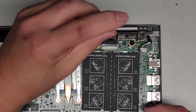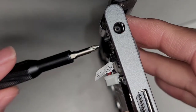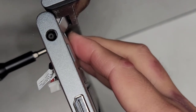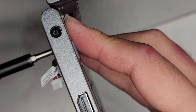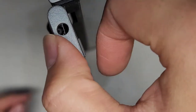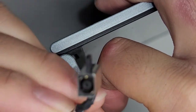Next we're going to open up the laptop to about 90 degrees, and then while it's open, we're going to undo the screws holding the hinge in place — there are two. You've got this screw here and this screw here, so we're going to remove those two. Keep track of those screws; you don't want to get them mixed up. I'm going to add some thread locker after doing this, just so those screws don't come loose later. Once you've done that, you can push this piece forward, slightly away from the screen, and that's just enough for you to lift this charge port out.